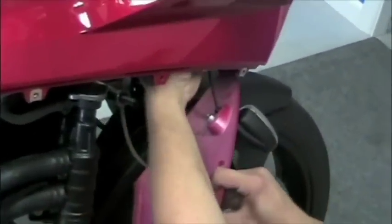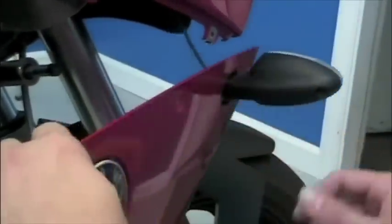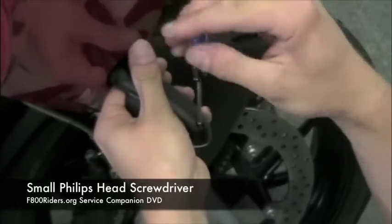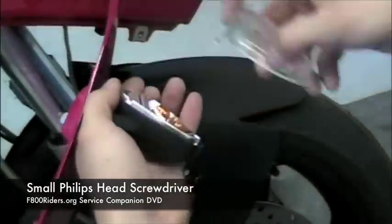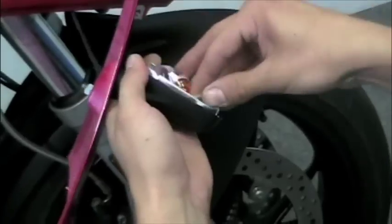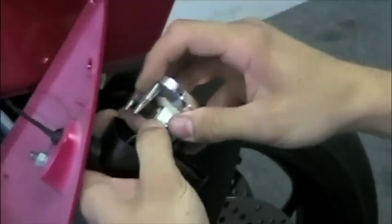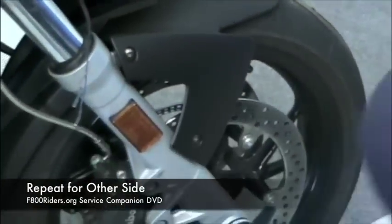After you remove all 5 bolts, there is also this nagging problem of the front turn indicator, which you'll have to remedy in order to completely remove the panel. To remove the front indicator from the panel, simply unbolt it from the back. Take the front cover off. The inner portion of the indicator also comes out here, as you'll see. And there are 2 tabs on the back that just pop right off and slide through the connector to detach the panel from the rest of the motorcycle.